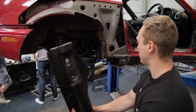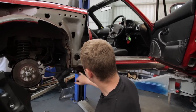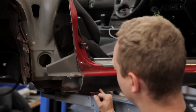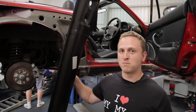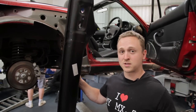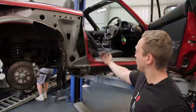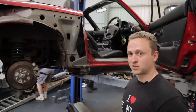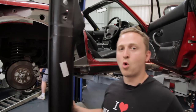There was a question mark over the state of the sills. Now we've had a look with a torch, the surface rust on the inside goes about six or seven inches. That will probably be the same at the front, making it uneconomical to cut the sill out here and at the front and replace those parts. I've got a sill replacement kit from Moss. So what boss Nick has decided to do is cut down here, take the spot welds out, fold it down, get rid of the old sill and replace it. Then I'll be left with a beautiful new sill and no more rust.